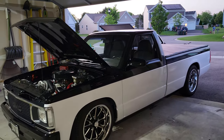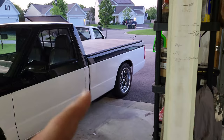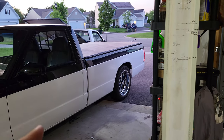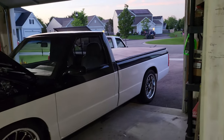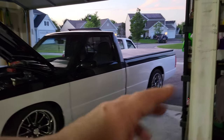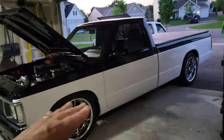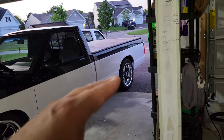I have a stripe that's going to go on — I'm going to surprise everybody in the video, I can't wait. The front's at the perfect height. The back has to come down another inch at least — I'm going to remove the bump stop brackets and add a one-inch, three-degree shim on the back. Going to get rid of the traction bars — I was going to go Cal Track but I'm not — I just want it to drive good.